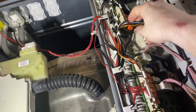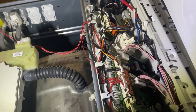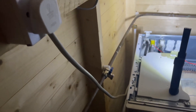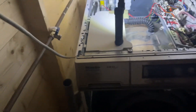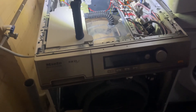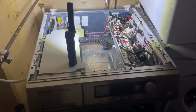All that you really need to do to convert one of these machines is just disconnect one of the heater relays — that's it, good to go. It's fine converting it to 13 amp. I hope that helped you. I hope this video was useful, as a few people have asked me about it and quite a few think it's not possible for these to be used on a standard electrical connection. But it absolutely is, and it's absolutely fine to use them on that. I just wanted to try and help those who asked.